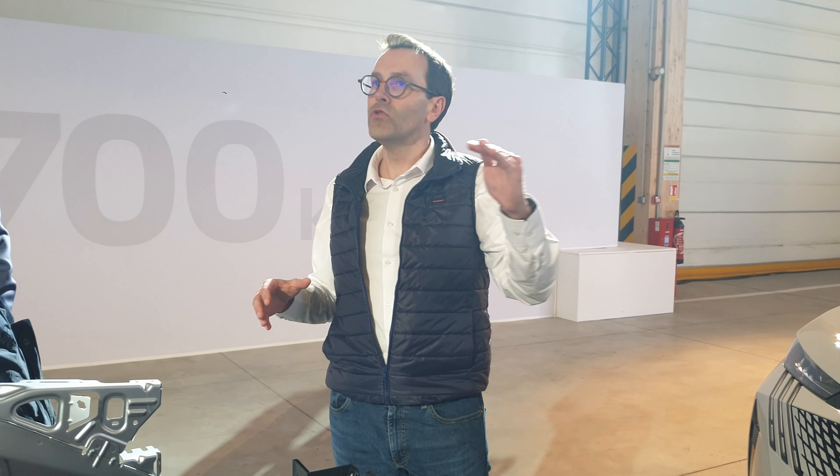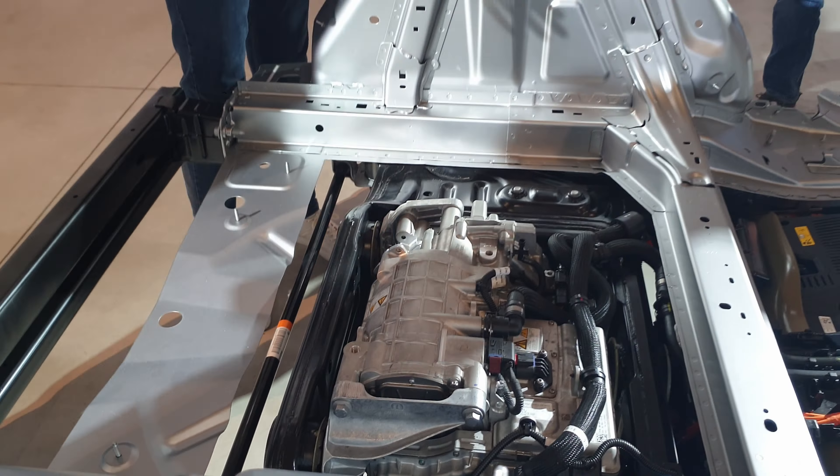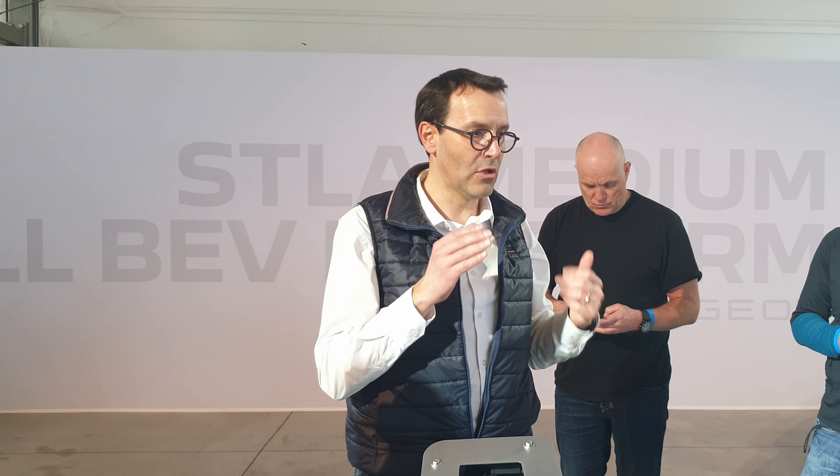At the rear, we have the rear machine at 80 kilowatts, giving 320 horsepower total in the all-wheel drive version. This machine is a coupled and decoupled machine — the philosophy is to have it coupled up to around 140 kph. When it's not needed, only the front machine works. When the driver demands strong acceleration in normal mode, the system closes the dog clutch and both machines work together, with torque distribution depending on road conditions.